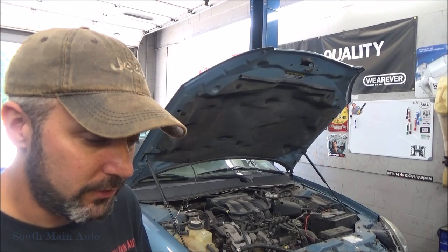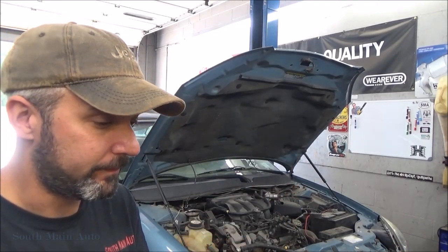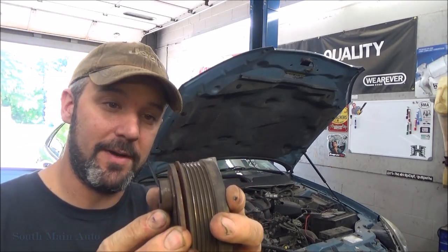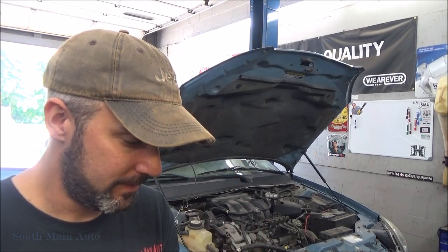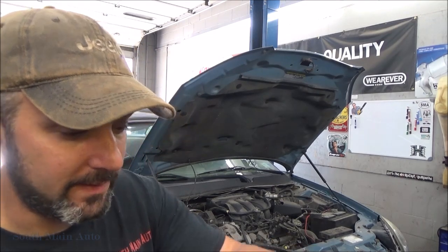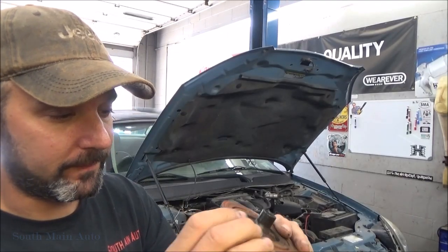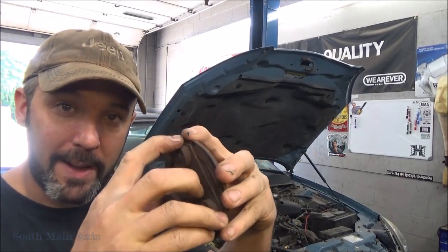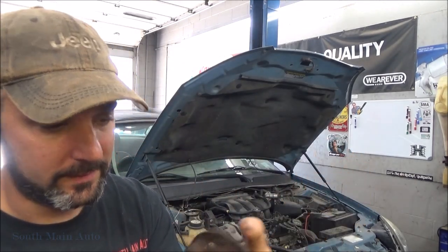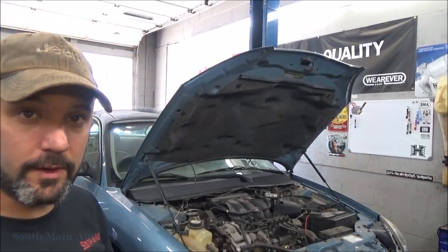And two, you could see, of course, I don't know if you guys could, when this clutch sat in the car, that it did not sit straight. The air gap wasn't even. It was all cattywampus. And I didn't have any reason to believe that the compressor shaft was bent or anything like that. What I feel is, obviously this clutch has to pull back under spring tension. I think one of them has gone wild and just wasn't sitting even. So we just ordered a clutch kit for it.